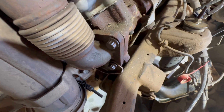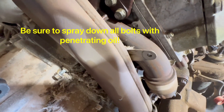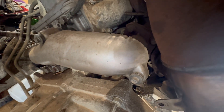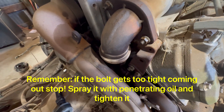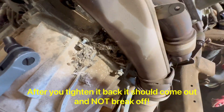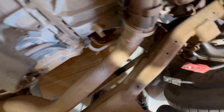Of course you'll take the 10-millimeter off here, 12-millimeter socket here — take the heat shield off, that's 10 millimeters. I'm going to do a new up-pipe for the driver's side and a new MBRP downpipe — it does have a CARB number so we're good there. We've been spraying these with Deep Creep and some other stuff just to break them loose over the past week or two so you don't have any surprises. Remove the transmission dipstick bracket right here, swing it around back, get it out of the way.